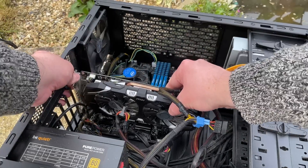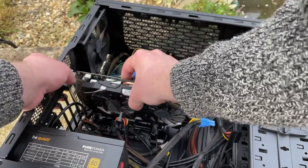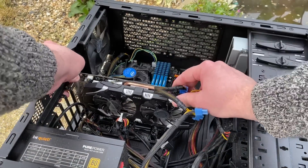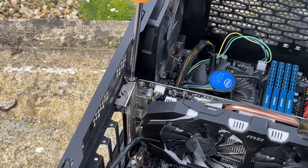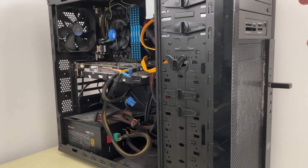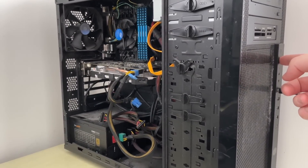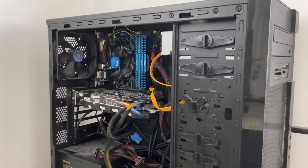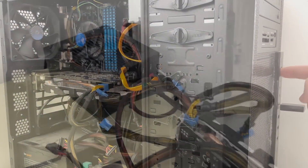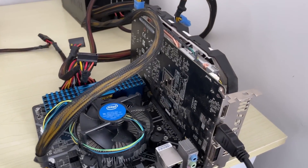I'm going to put the card back in the slot properly before trying to power on the PC. Despite the dust in here, I'd actually recommend not making any effort to clean up a second-hand system until you've powered it up first. If you tinker with things before testing them you won't know if the damage was already done or not — better to be safe than sorry. Attempting to power on the first time failed completely; there seemed to be no life from this PC as described. The next step was to take everything out of the case and test it bare-bones style, hooking up the key components but nothing else. I kept all the RAM modules in the slots to see if everything would be recognised in the BIOS, but we didn't get that far because it didn't boot up.